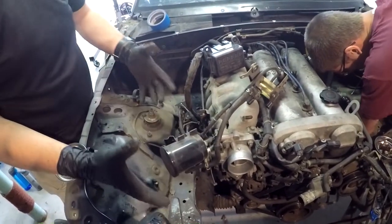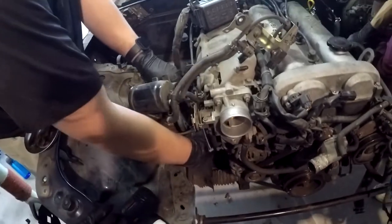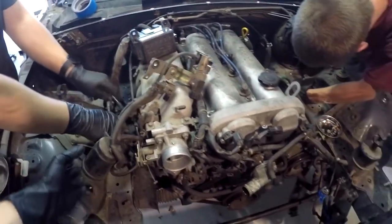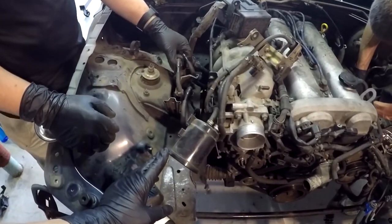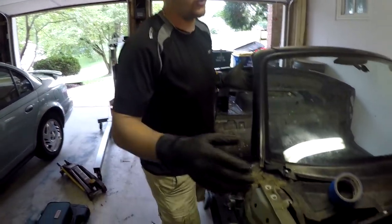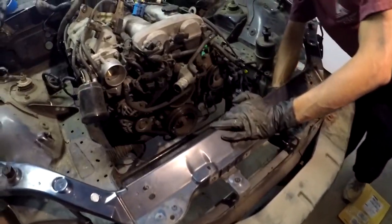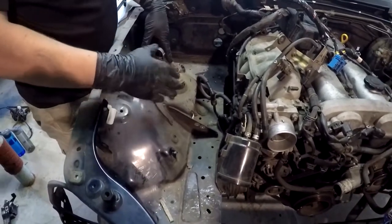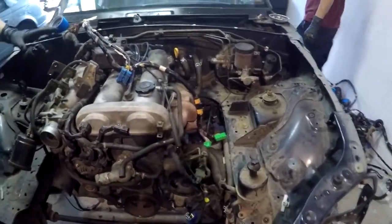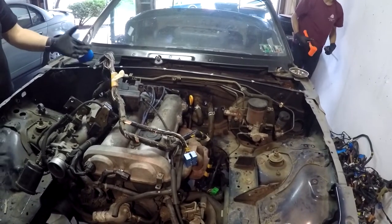It's kind of like an expansion canister, and you'll see some sensors associated with that. There are hard fuel lines that come up and return back to the tank — that's what all these guys attach to. We're unhooking those and getting them out of the way so that when we need to clear this stuff off the body, it'll be out of the way. We're getting everything clean and free from the body. Up front, we've pulled what's left of the wiring harness through the firewall, taken away the large fuse box from up front. Everything attached to the body — the power steering reservoir, all these types of things — we've disconnected all of them. There are 10 millimeter bolts all over up here, and we're packing everything in over the engine in anticipation of soon unbolting things from the body.